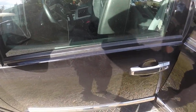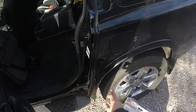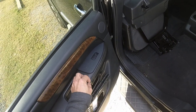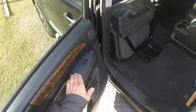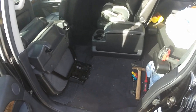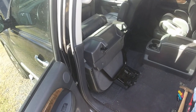I have a 2010 Nissan Armada and I got a fuel pump that's starting to go on it. I've been having problems with it starting when it sits for a while — the pressure bleeds off on the system. I'd have to do the whole key on, key off, key on about three or four times just to prime the system again to get it started, and it started hesitating under load, so that's a telltale the pump's getting weak.